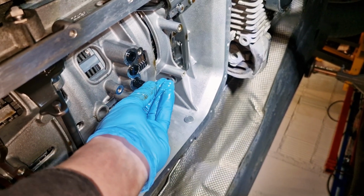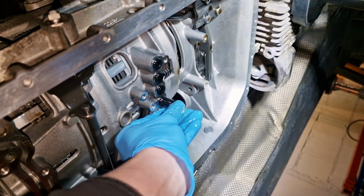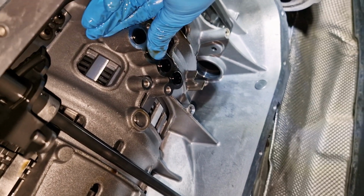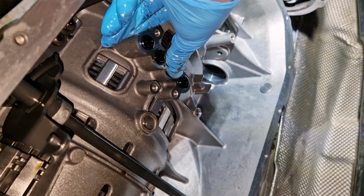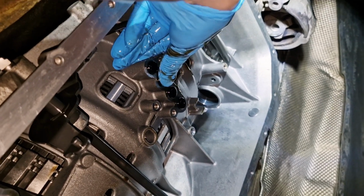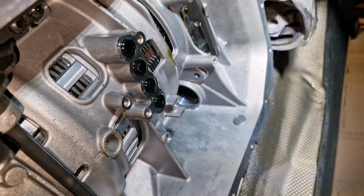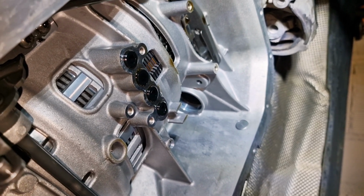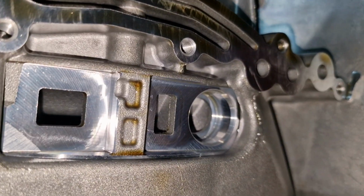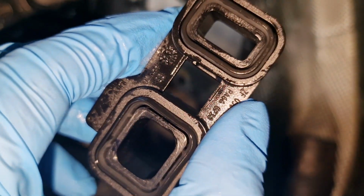The short one. And another short one. Push them a bit more to make sure that they sit properly there. New seals. So this is how it should look like compared with Baiko brand. This is original BMW. Sits perfectly. Okay, the place for the mechatronic adapter, and on the mechatronic adapter I put some little amount of ATF oil on the seals here.